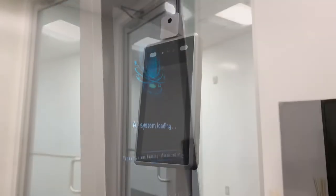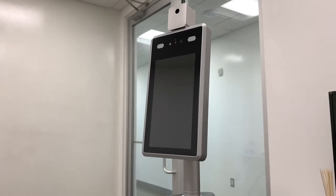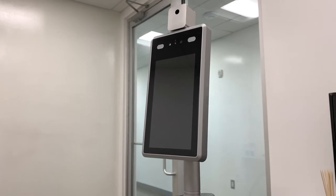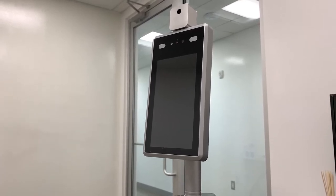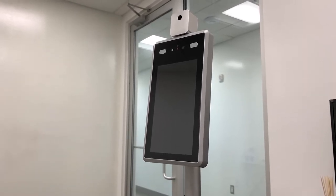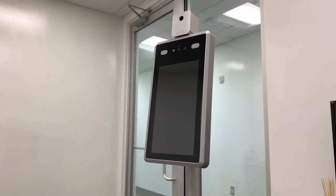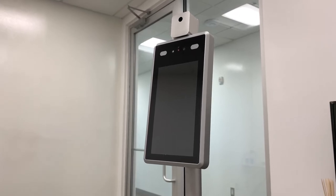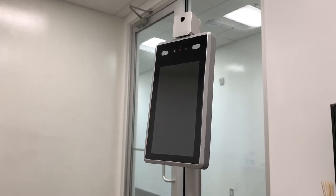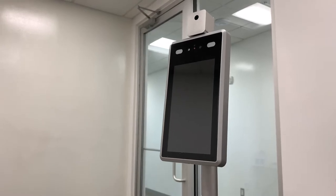Still booting up. Alright guys, got into the software. You just connect it to your network — it has a static IP and they tell you the IP address, so you can get into it really easy, unless you've got an IP range like we do which is not even close to theirs, so we had to do a little configuration to set up our IP. It is not by default set on DHCP — it's on a static. The software is pretty straightforward, the videos are simple, and they explain everything you need to do to set it up.